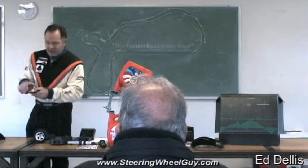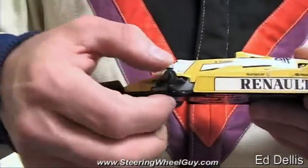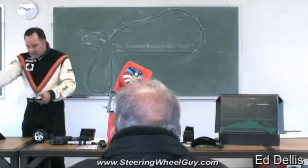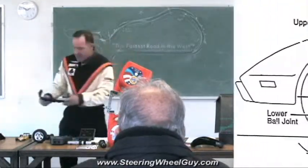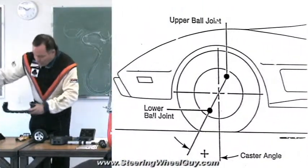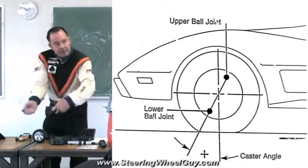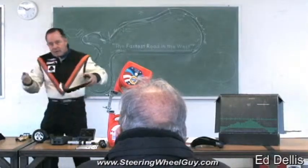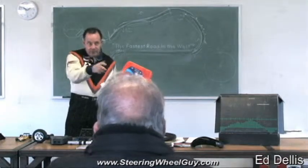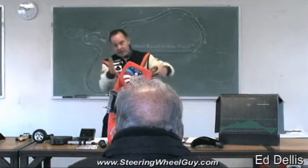And it has to do with the fact that it's called the steering axis. Meaning, if the wheel is not turning 100% vertical in this direction, but instead is laid back a little, what happens is the contact patch is behind the steering axis, because the steering axis points in this direction. So the cornering force here can actually turn the steering wheel, which is why when you go into a corner, you have to put a little bit of extra force into the steering wheel to get the car to go around, because that contact patch is pushing it.